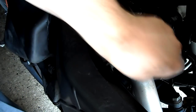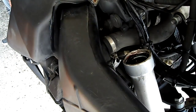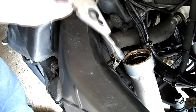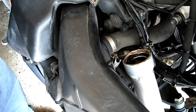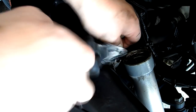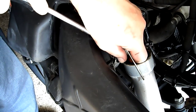Prise off the dust seal as shown — nothing holds it in, it's just a push fit. Then you need to remove the crinkly circlip washer, which is a strange looking clip that runs into a groove all the way around the top of the fork tube. It's quite easy to get out but it can get stuck in there with crud and dirty oil, so you just need to be a bit resourceful with a screwdriver and prise it out — it comes out quite easily.